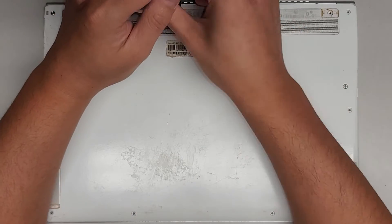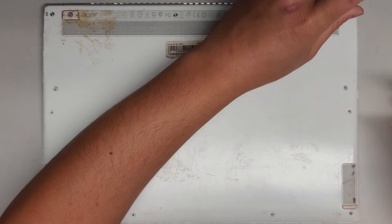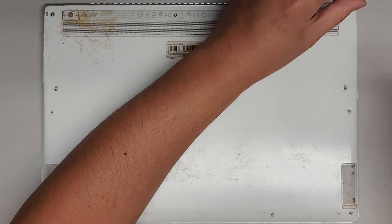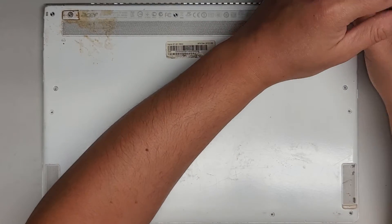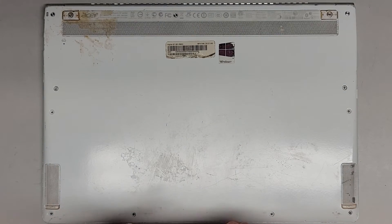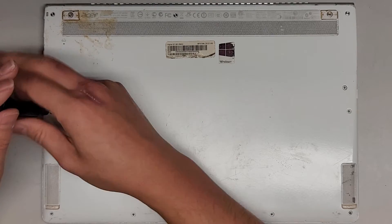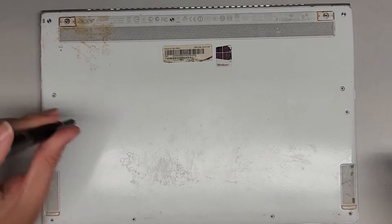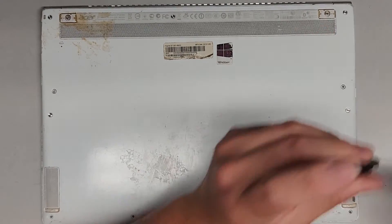Other than that, you're welcome to stay as I put back all the screws — but that's all there is for this model. I am going to again try to do the Windows install. If you're trying to get into the BIOS, I believe it's F2 — you might have to hold the Function key and press F2 to get into it. Then you can move around the boot devices. I don't know if there's a special key to do a temporary boot device selection.